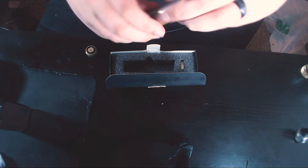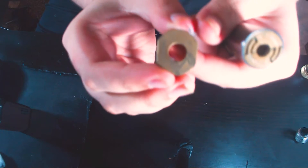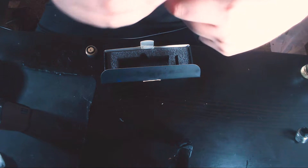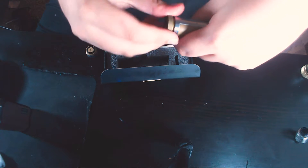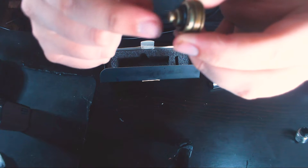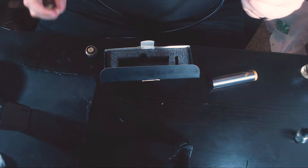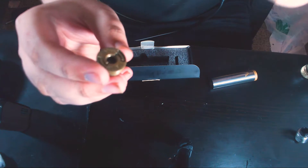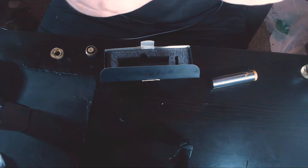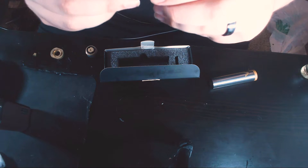The tool is used to take off your top cap or 510 connection. You just pop it in, give it some turns — this thing is kind of a pain to get in, not gonna lie — but you give it a few turns and out pops your 510 connection. You've got a pin right here that connects to your battery, and this also adjusts for battery rattle. You've also got this piece which adjusts your 510 — so if your atomizer is a little longer on the 510 pin, you can adjust it accordingly.